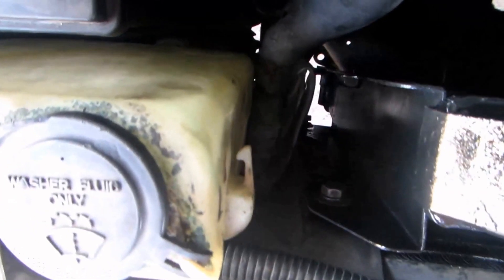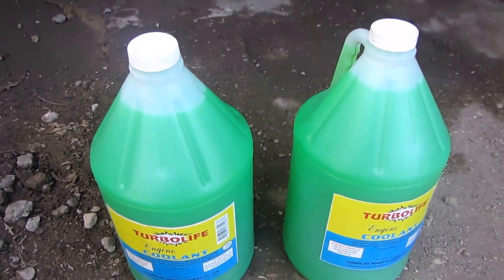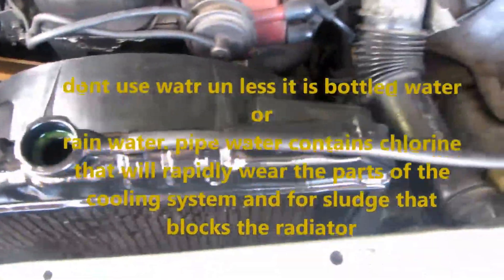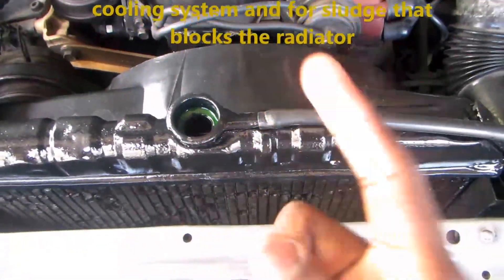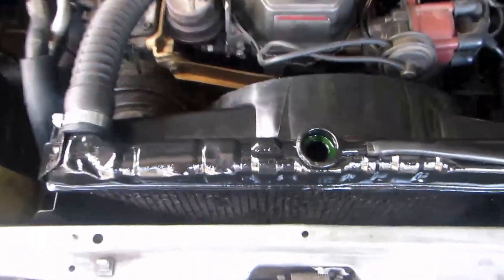Put in the mounts on the side of the radiator, put it in your shroud, then catch the upper radiator hose and you'll be done. Now it's time to get your coolant and pour it in. Fill it in until it's full — that's when you're finished guys. Then you start the vehicle and let it circulate to get all the air out of the system.